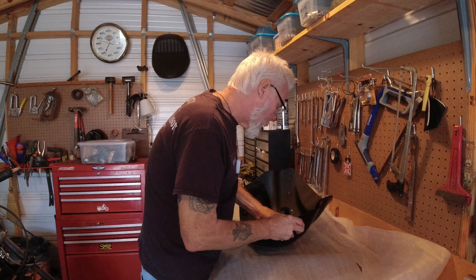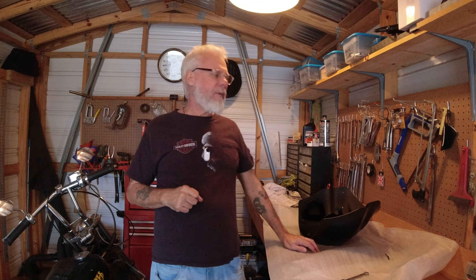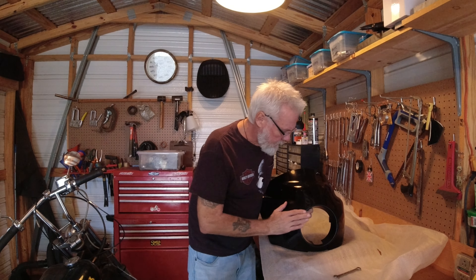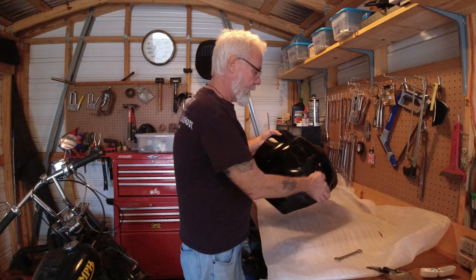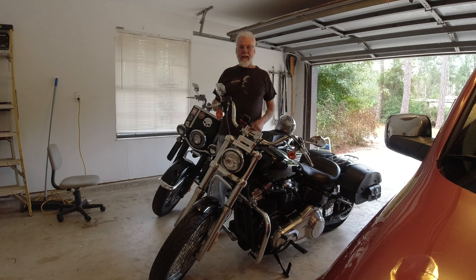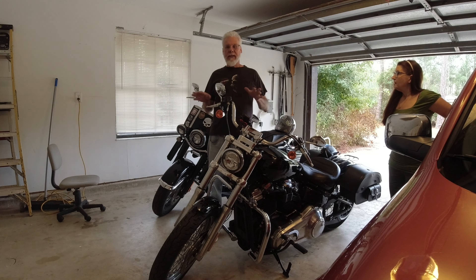Okay, next thing you're going to do is move the headlight. I'm going to have to move the headlight forward on that bike, because if not, your headlight is going to be recessed in here and it just won't look as good. So the headlight block we're going to install is going to bring the headlight pretty much flush with the front of the fairing. Before we move the headlight, we're going to check the beam against the wall here in the garage to make sure it's going to be at the same location after we move it — because we're going to have a little adjustment this way or that, and we want it straight.